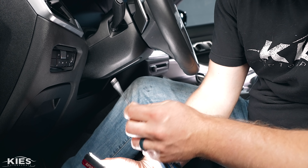Here's something very important that you don't want to miss. When we remove the wheel, do not touch this black plastic in here — if you mess that up, you're going to have a really bad day. You'll notice on the steering wheel there's a little groove, and there is a little notch. BMW engineered this as a spline system, however at the bottom there are no splines — it's perfectly flat. That makes removing and installing the wheel super easy. But if you have it the wrong way, it's not going to go on. Make sure you line those two up and it's literally going to fall off with no effort at all.